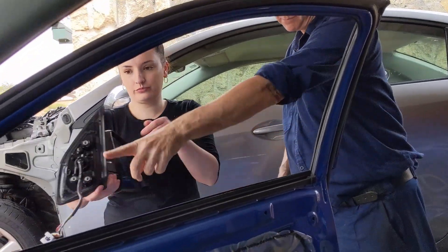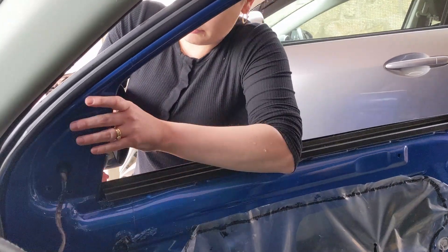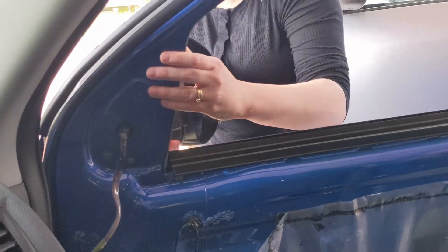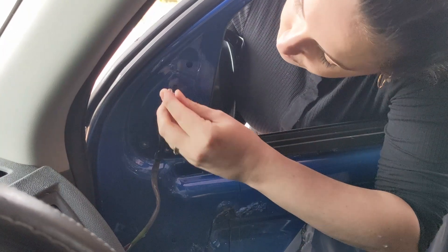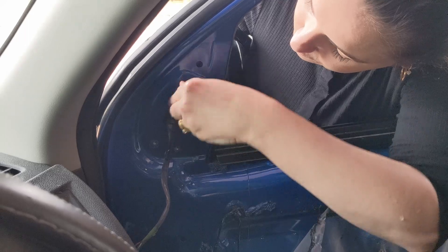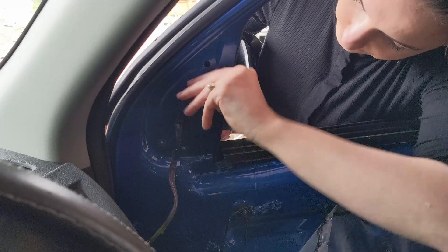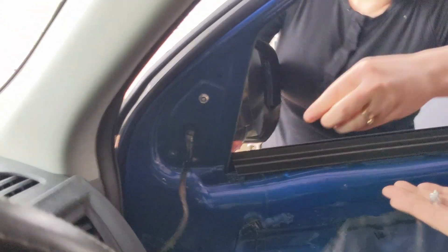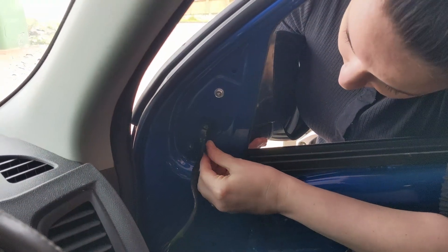Now it's just a reconstruction of everything else. Feed that piece of wire back through the hole it came from and seat it so that all the holes line up. Just run one of these in by hand — just get it started, you don't have to finish it, just start it so it holds it in place. Then do number two and number three. If you line up the bolt holes, then the rest all lines up.